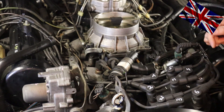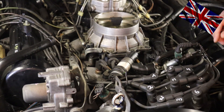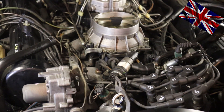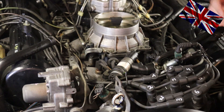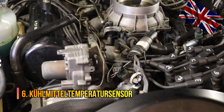Have a look at all vacuum and pressure hoses — check them all, including the spots where they are connected. Check for cuts and porosity. The yellow lines are commonly used for the central locking system, which makes it easier to distinguish them from others. Maybe you find a foam rubber hose end without another hose connected — check if it has simply disconnected by falling off.